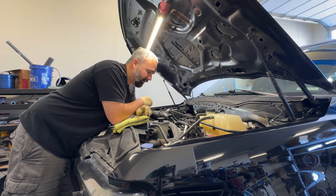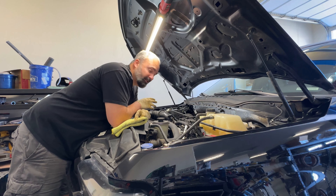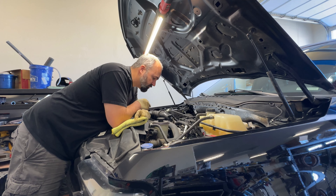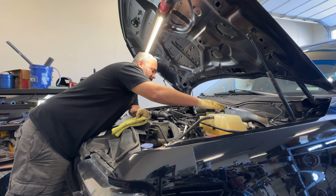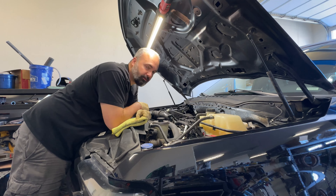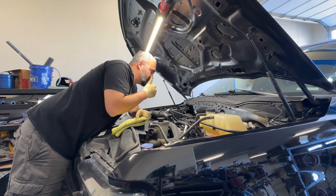See if you notice anything abnormal — something to look for would be oil trace from your power steering, coolant leaks. You're not really going to have a brake leak because then you wouldn't have brakes — that would be a bummer. Besides that, not much else to talk about under here. Let's get underneath.